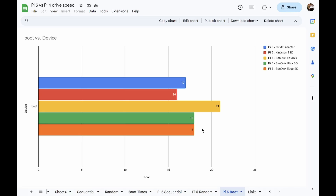One interesting thing was testing boot times with overclocking. I set the CPU clock speed to 3 GHz — it was not stable at all, crashing and locking up — but I was still able to test boot times. The boot times were exactly the same with the CPU overclocked versus no overclocking at all: the NVMe was still 17 seconds and the SSD 16 seconds. So overclocking does not make a difference in boot times on the Pi 5.